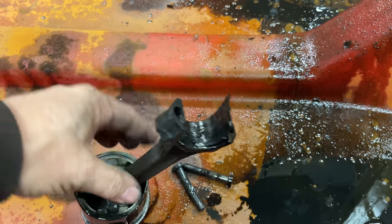Here's a chunk — oh, this is the nut that would have held that rod bolt in. Looks like it got chewed up pretty good. Well, there we have it — we found out what went wrong. The next step is to get the crankshaft out of the engine and take it to the machine shop and let them tell me if the crankshaft can be saved. If it can't be saved, then I need to think about whether I want to rebuild this engine or get a completely different engine.